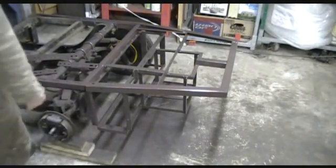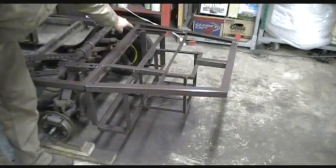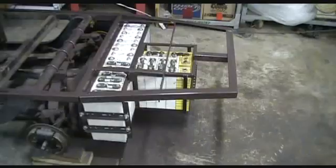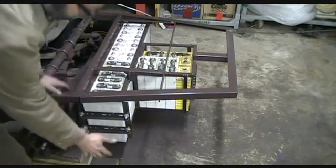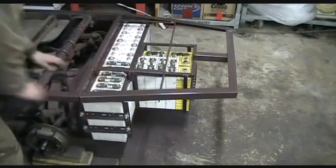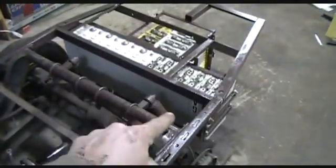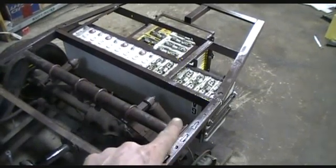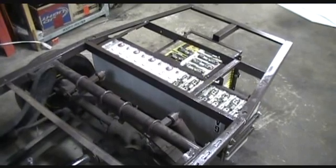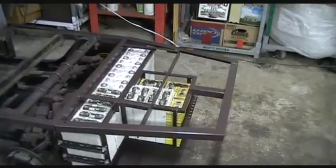I'll paint it up, put some batteries in, and we'll be good to go. Before I put batteries in, I'm going to put in some covers nearest the wheels of sheet aluminum or maybe even corrugated cardboard, just to protect the batteries. Another major hurdle down — compressed, two brackets here, nice and light, clears the tires fine. This is Coroplast, and it's also a hunk of Coroplast. Down there you can see the word 'GA' — it actually says 'no gas,' originally for another electric vehicle that I dismantled to put this one together. You can see 16 batteries on that long section, four white ones in the back which constitute the main pack. So that's done.